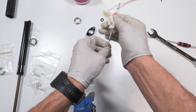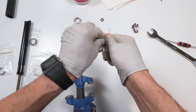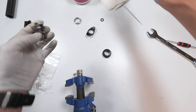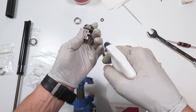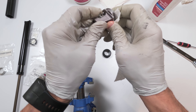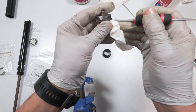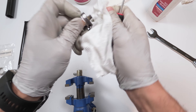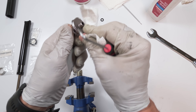Clean all the parts that we took out — clean them best you can. These aren't that bad, to be honest. With the actuator, what we are going to do is take alcohol. On the inside there's grease — we just want to clean it out as best we can, getting all the old grease out from in there. What you can do is take a pick and clean it from the walls of the actuator. We're going to apply new grease in there. Make sure we clean all the threads of the actuator.